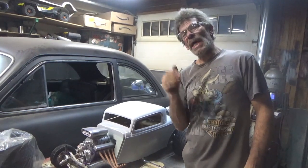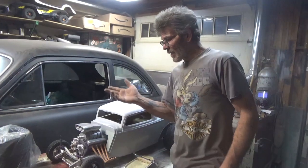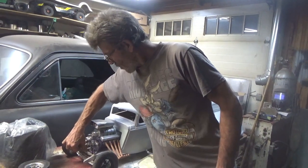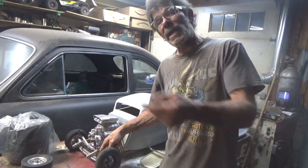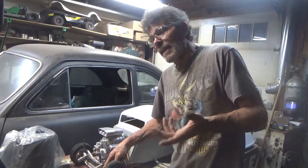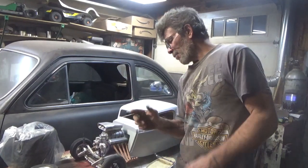First thing I did was to see if I could throw a hole through it, because it is a different type of metal. I got the hole through it, got it cut to size, and it works freaking awesome. I've got a shackle system now on the leaf spring. I actually had the leaf spring just kind of zip-tied to the straight axle and I thought that was cheesy, so I got the straight axle on there with the axle tipped back at a nice degree.